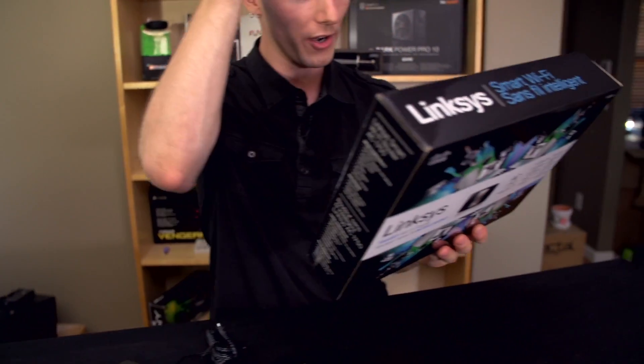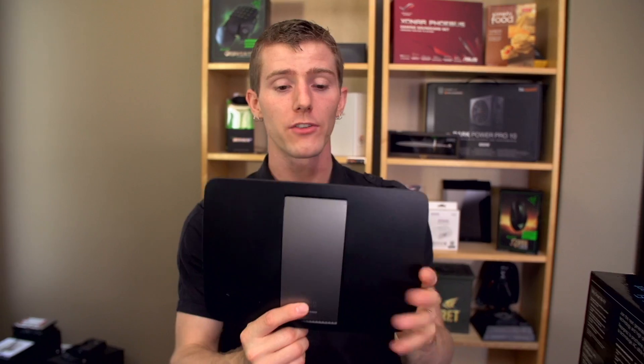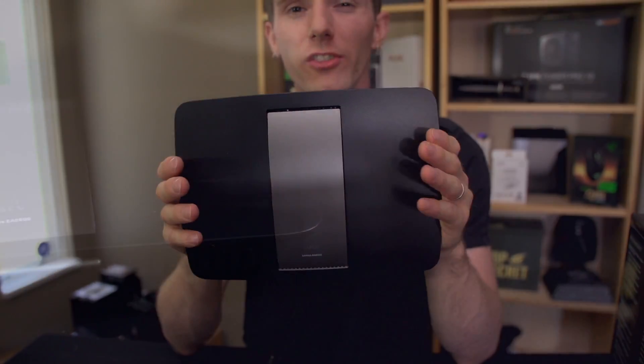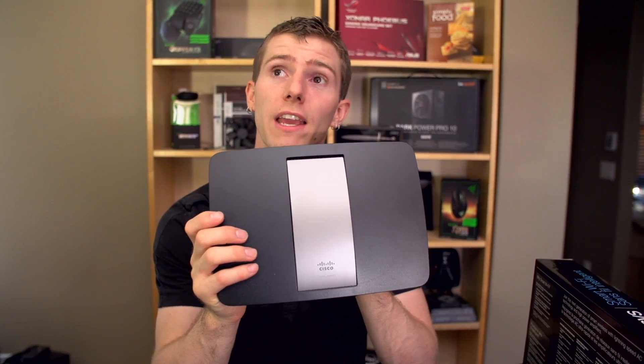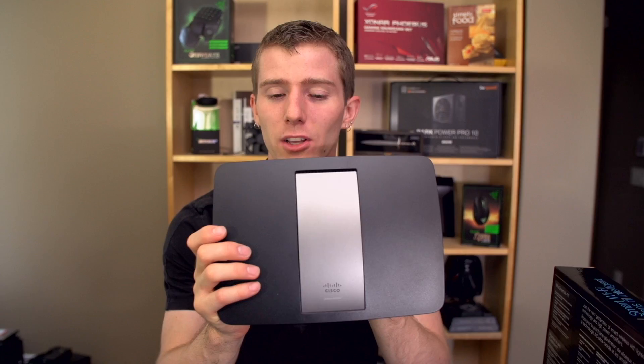The last things to mention are the high-powered amplifier for ultimate range. Remember, 5 GHz routers do not necessarily have the same kind of range as 2.4 GHz routers — it is inherently a shorter-range technology. But what's good about it is there's less potential for interference, whether it's from your cordless phone, other wireless networks around you, people who haven't upgraded to 5 GHz, microwaves, or whatever else. So you might get more effective range out of it. They also have lots of parental controls, and I personally find their firmware easy to use and quicker to use, because you don't have to reboot your router to apply any changes — which is something people using aftermarket firmwares take for granted. When I compare this to something like D-Link's latest AC router, which requires a 300-second cooldown when you upgrade the firmware and a 90-100 second cooldown when you apply any changes, this is much faster when trying to diagnose any random network issue.